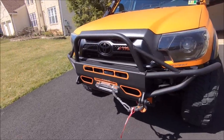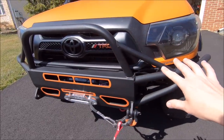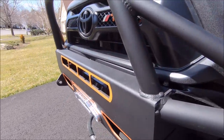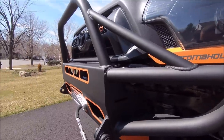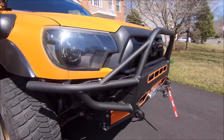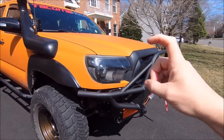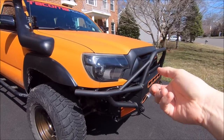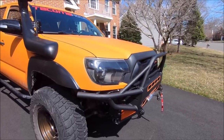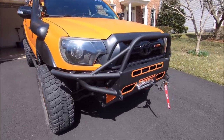Just like with my sliders and rear bumper, after cleaning it off with degreasing wipes, I used some self-etching primer. Then I used a sort of flat black enamel. I did not go with bed liner for this, because the last few cans I've used, I've had difficulty — sometimes it won't even spray when the can's upright, you have to turn it upside down. It's been a huge pain, and sometimes the bed liner splatters. So I decided to switch it up for this painting project, and I'm very pleased with how it turned out.